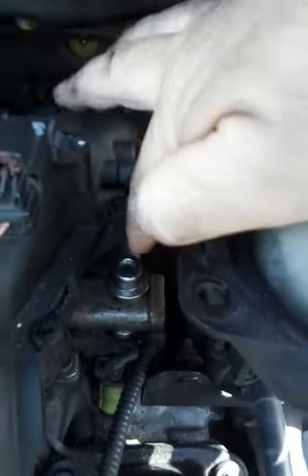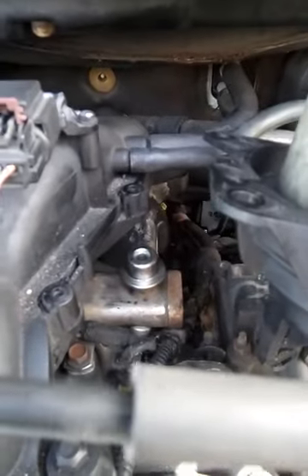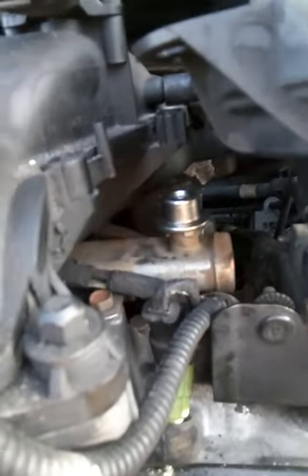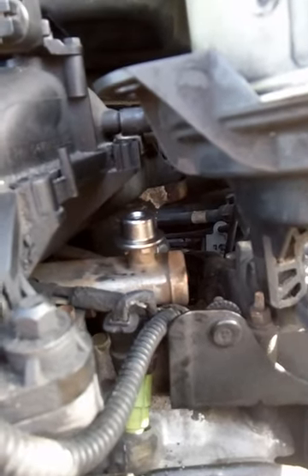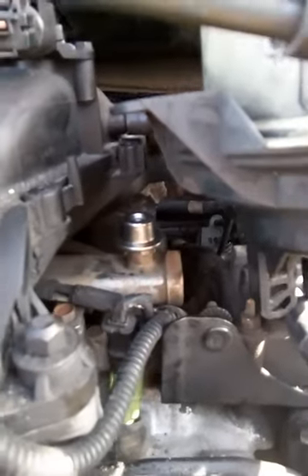This thing right here is a test port. That test port leaks, and that's what has the O-ring on it. To get it off, there are little tiny teeth underneath that clip it on — five of them — and the thing kind of spins. There are little prongs under there; you've got to bend them out with a screwdriver. It's a pain, but you can get them off. Then you pull the thing up and the O-ring is on that. Put it back on and bend the prongs back. The fuel leaks out here and then you smell it in your vents — you smell it everywhere.